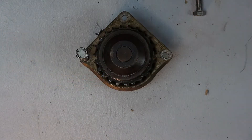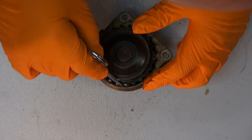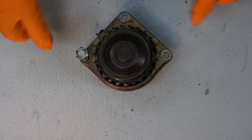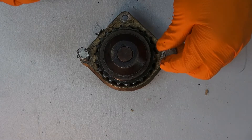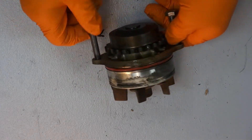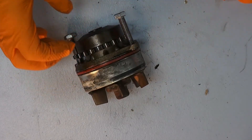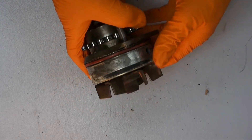The timing chain engages right along in this part here. When you slacken the timing chain by turning the engine backwards about 20 degrees, you can actually see the chain come off and become disengaged from the teeth, and it will clear this round edge. Remove the three bolts, being careful not to drop them into the motor — I used a magnet to catch them. Then thread in the jacking bolts and tighten them evenly, about a half turn each, and the water pump will come out. Once it's a little loose, you can grab it by the bolts and wiggle it out.